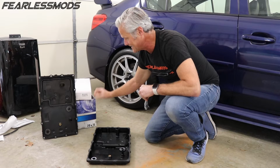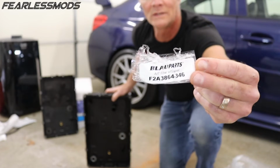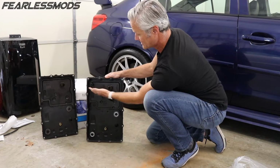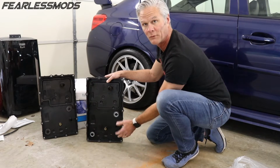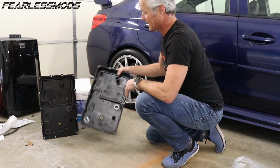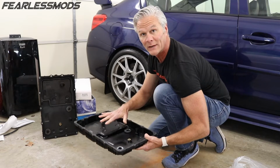The difference is in the part number here, a 214 versus this new one, which is a 346. So in fact, it does have the two risers here. This is the correct filter for this, what was the Stinger application. So when we're ready to go back in here and actually do the filter change and the 3 flushes, we'll be ready to go.